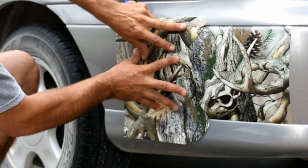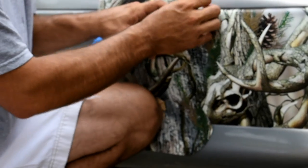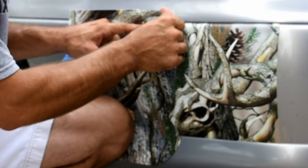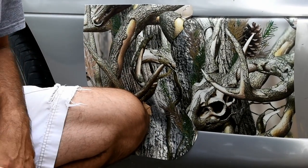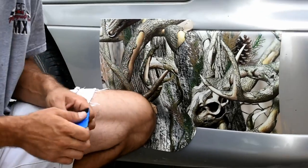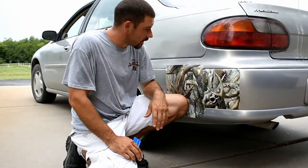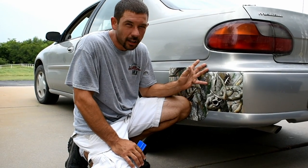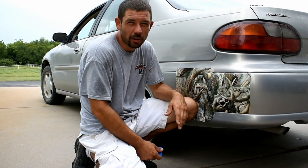Because we're splicing in on the trunk, I'm going to go ahead and put the trunk over it. When I like its positioning — it looks like this vinyl is falling off the backing paper because we just tried to shoot this video and I had to peel it back off. The good news is this Avery wrap vinyl is super forgiving. As long as you don't get dirt in the adhesive or cut the vinyl, you can heat it up and it'll go back to normal exactly like it was when it started.